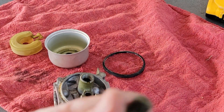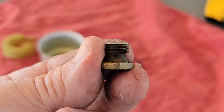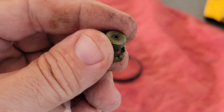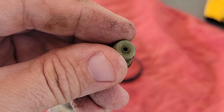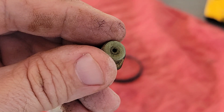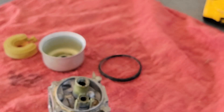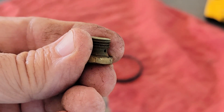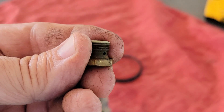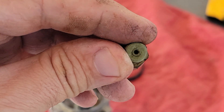In the bottom, the nut that holds that bowl on — you'll see there are holes, one on each side, and right in the middle is the jet. That's your high speed jet. When that gets plugged up it will not run. All this junk from the ethanol plugs up this bowl nut, and your lawn mower, your generator, your pressure washer — anything that has this type of engine on it will not run because that little hole is plugged up.